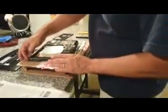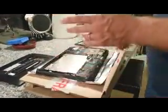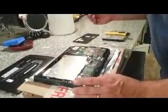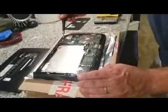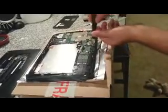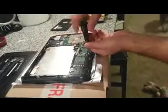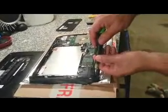You can take off the stylus pin so you have some room. Then come back — there are several screws on this side that you want to take off. One is here in the upper right hand corner, one on the right hand side, one right below it, and one down here — so that's one, two, three, four. Then you come over to the bottom side, away from the pin, and take off this screw, the screw next to it, and the one next to this white connector. The last one will be right here in this corner.